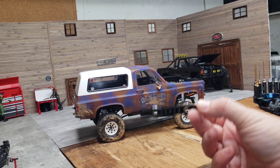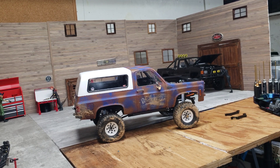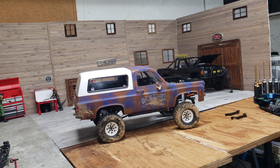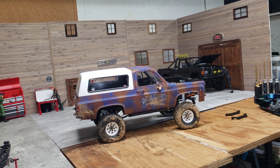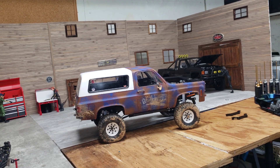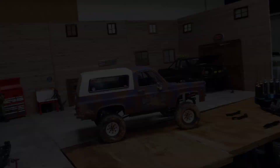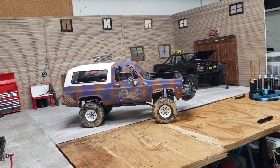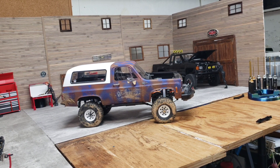So this is the straight bumper I was using in the short videos, if anybody follows the channel. We're going to stop here and I'll do a little mount-up with the one they recommend first - the number three - and then I'm not even going to waste my time mounting it with the number two, because it puts the bumper in a bind up front and pushes down on it. We'll start with the one they recommend and I'll go mount it off camera.